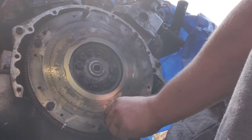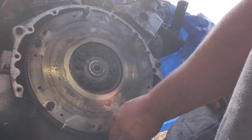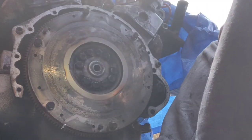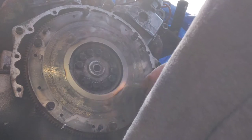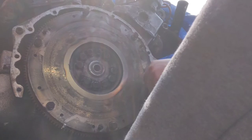and then welded the ring gear to the teeth. So I think what he actually did is you heat it up. If you heat this one up and you chill that, as the metal expands, you put it on, it cools down, it clamps it. It'll never ever come off. And then obviously a little bit of welding grinds it all flat. And away you go. I understand the theory of it, but it's way beyond my skill set, to be honest.